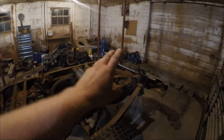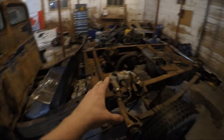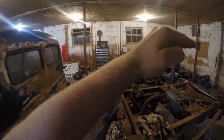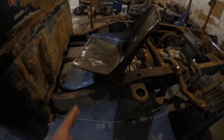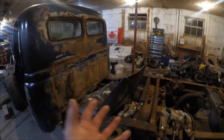Before we go underneath, let's address another elephant in the room — this frame is no way ever gonna work with our box outside, and there's very good reason for it. The F-150 frame hikes up like this, relatively straight, but at the back it kind of dovetails a little bit right where the sleeve section is. What I'm getting at is we have to modify this frame section and make it adaptable for our 1954 box.